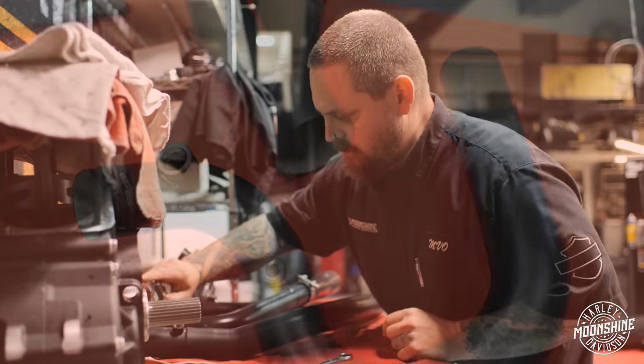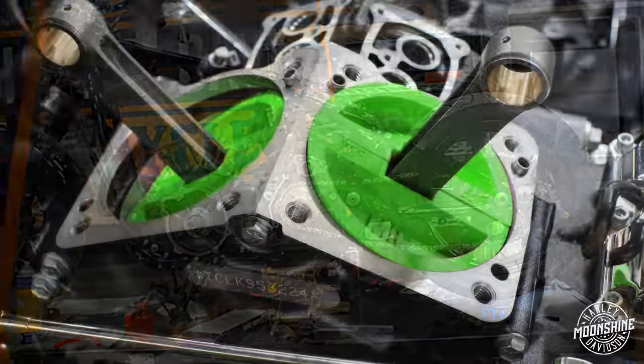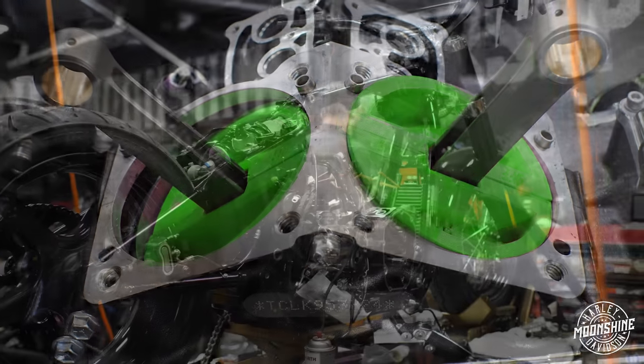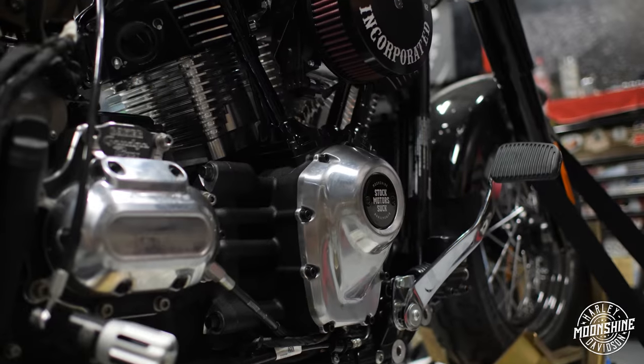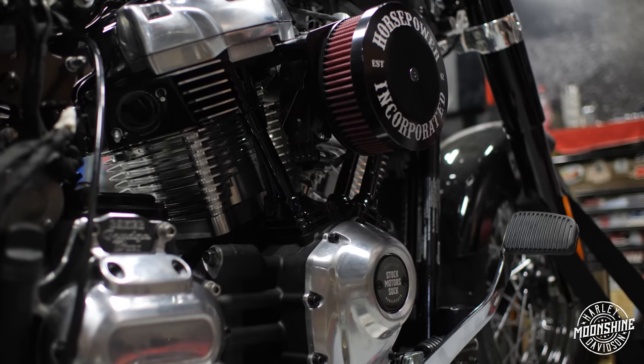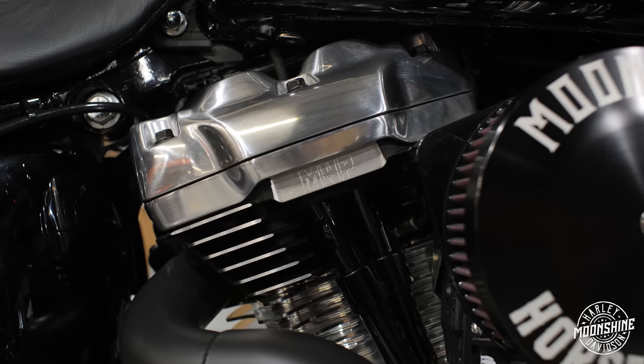We're able to run such large pipes because we'll have enough air movement through the engine's displacement to compensate for what would typically be a dead bottom end. The 147 uses a four and a half inch piston with the S&S flywheel stroked to a 4.625-inch stroke. S&S normally pairs that with their shorter rod, but we went with the conventional 8.015-inch Carillo rod. Since it's stroked with the Carillo rod, we had to make the cylinders one-sixteenth of an inch taller to compensate. We kept the piston pin in the same position as a 143 application. There were also custom modifications needed to ensure the pushrod tubes and pushrods work correctly with the motor.